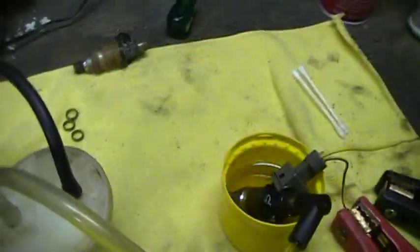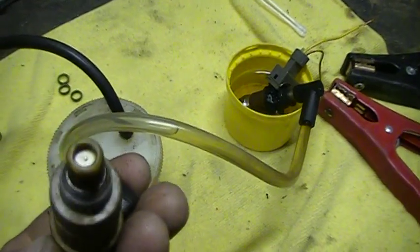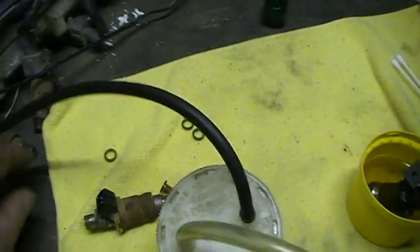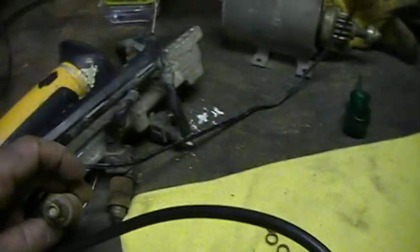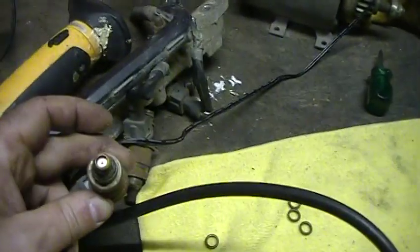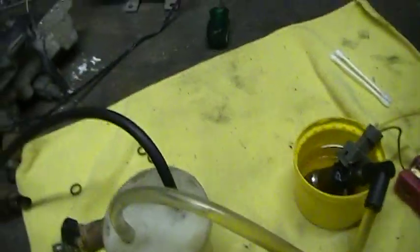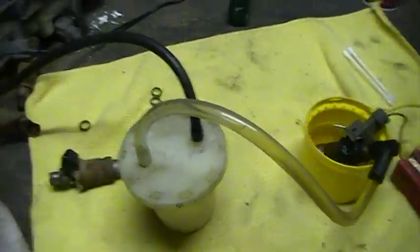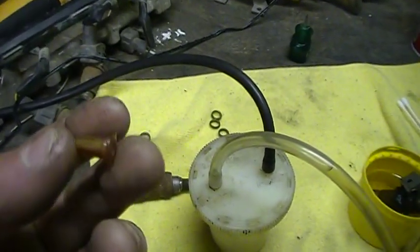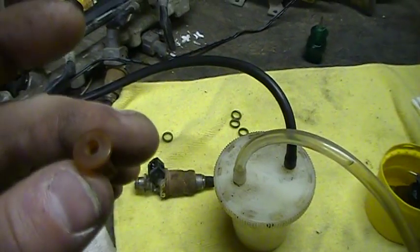This is an old injector from the other car — you can see it's pretty nasty. This one actually on the inside of the end is kind of clean, but over here there's some that aren't so clean. I usually take a Q-tip and clean out the inside with some injector cleaner, and obviously clean up the case on the outside. Replace the gaskets. These little screens that go on the top of them usually get a little crudded up — you can't really see real well on the inside of this one, but this one's pretty clean.